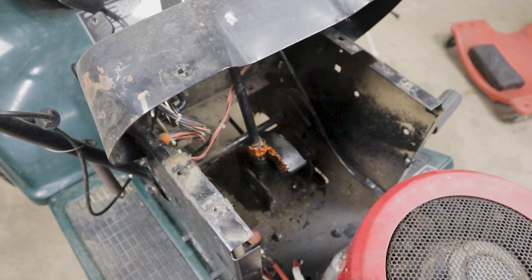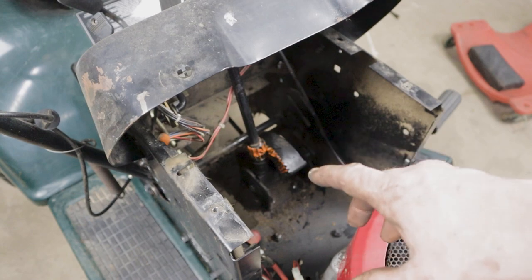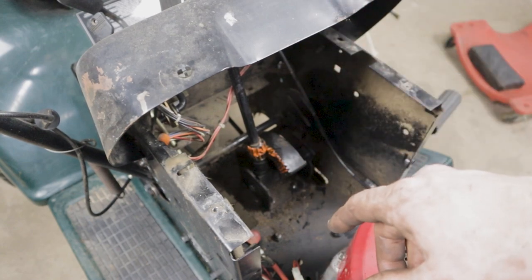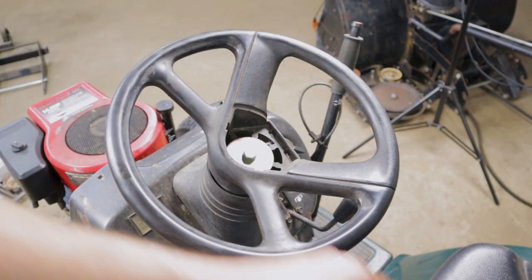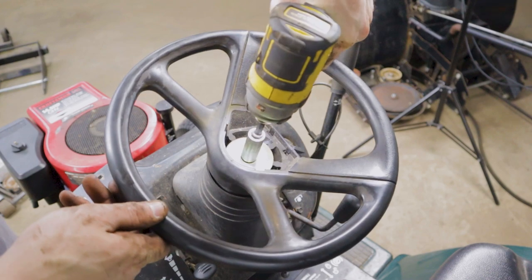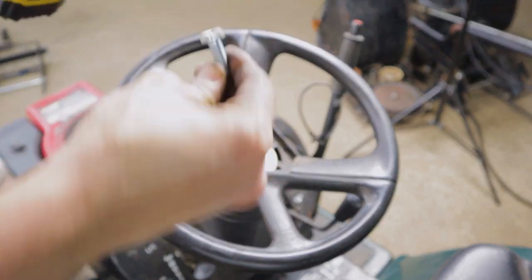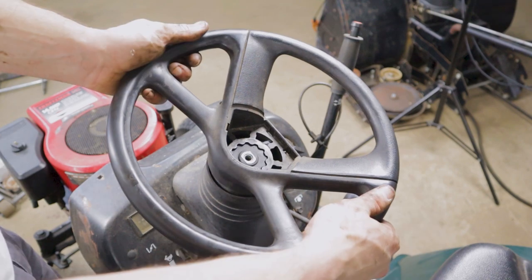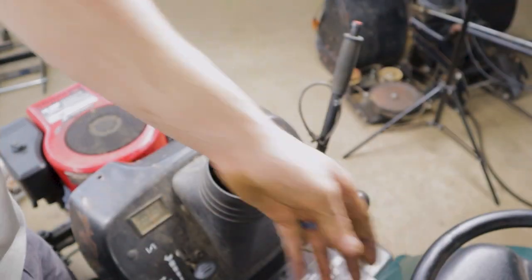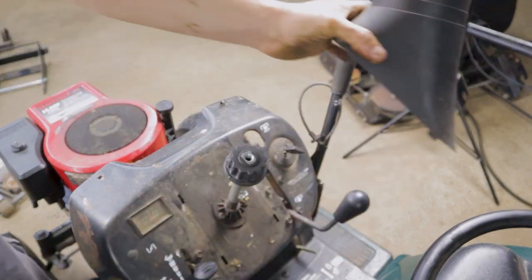You can see there's a little bit of grease there, but if we go ahead and test the wheel, there's almost no slop in that steering wheel at all. One thing I noticed is the steering wheel is not straight, which is okay because it moves us on to the next thing we're going to replace. So let's go ahead and get the steering wheel off. Up here on the steering wheel there's just this plastic cover - you just pop that off with a flathead screwdriver. We've got another 14mm bolt right here, and there's a lock washer and then a big washer on top. Then we can take the wheel off and pop the shroud off.